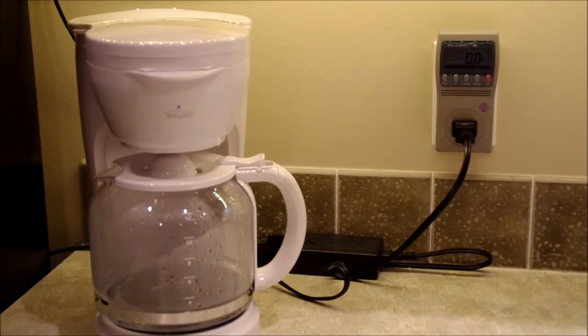They don't really have something like a dimmer, if you will, that will be able to limit the heating element's consumption to like 300 watts. They'll basically stay off, and then once the thermostat determines that it's too cool, it'll kick back on and the heating element will shoot back up. Now these coffee makers, if you watch the video that I talked about earlier from the engineer guy, link in the description, they have one single heating element. The same heating element both heats the water as it makes the coffee and keeps it warm once it's done.